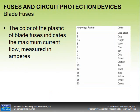You've probably seen a lot of different types of fuses. Basically, the fuse is a small wire. A blade fuse consists of two metal strips connected by a filament and insulated with colored plastic. This colored plastic is standardized by amperage rating: a 20-amp fuse is yellow, 25 is white, 15 amp is blue, a 10 amp is red, and so on.